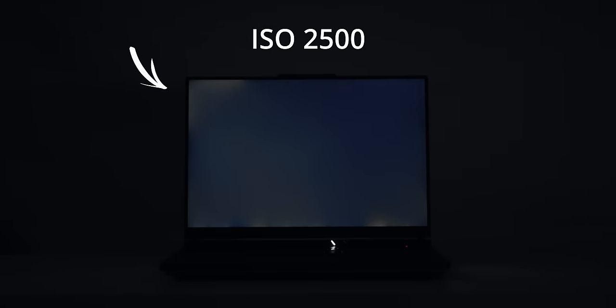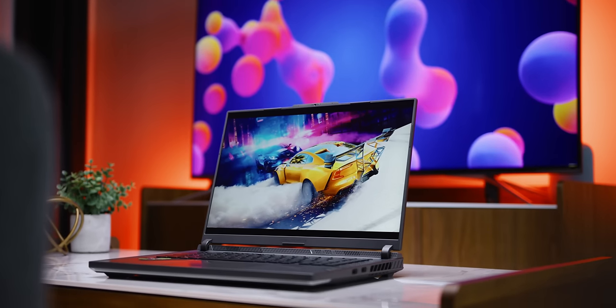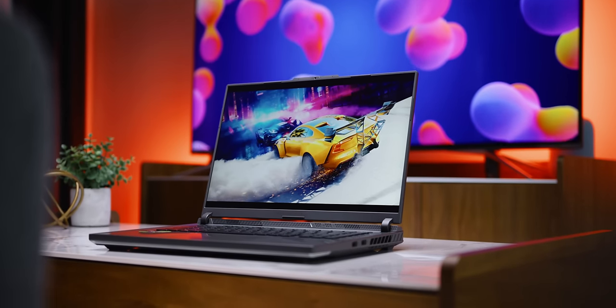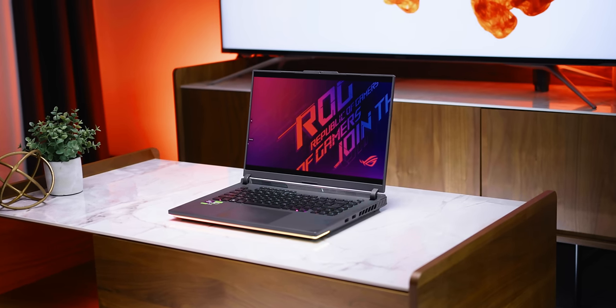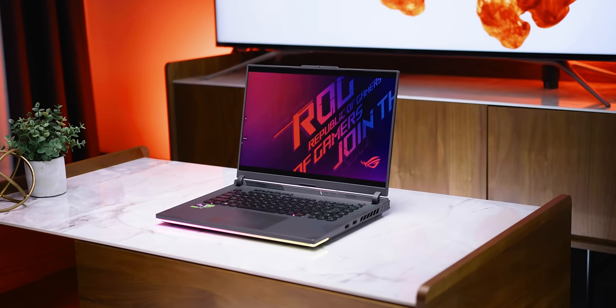and that's the horrible backlit bleed that some of you have been experiencing. Well, it's true, I've been noticing it myself. This panel exhibits some of the worst bleeding spots around the corners, notably the top left-hand side on my sample. That's just not acceptable for a laptop in this price range, and it gets distracting when you're watching movies at night. Now keep in mind, this is a Nebula display and not Nebula HDR that comes with the SCAR Intel series that supposedly has better color gamut and better brightness levels.